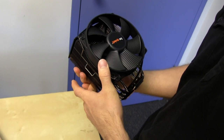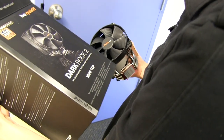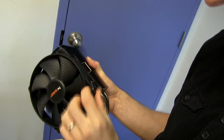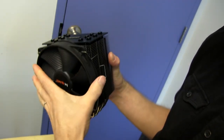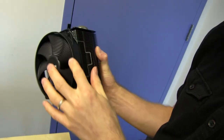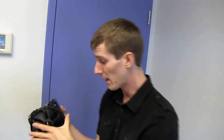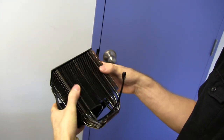Is that a 120mm fan? Because that doesn't look like a 120mm — that looks like a 140. It's actually a 135mm fan. This is a bit of a unique design because it's using a completely different mounting system just for their CPU heatsink fan. It's got a rubber ring all around the outside, so without any cheesy little rubber strips that you have to stick to the heatsink fins — and then they fall off and your cats chew them up — the fan will always have the rubber layer on it, which will keep vibration from being transmitted to the tower heatsink itself.